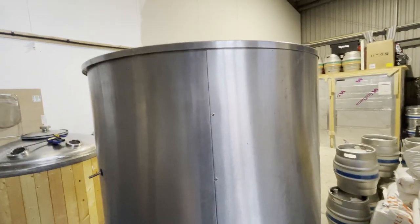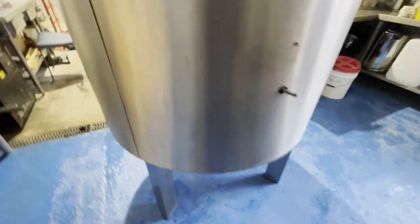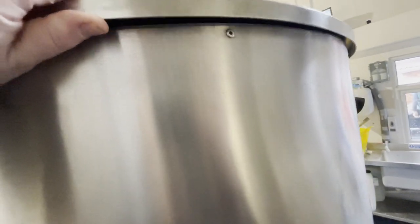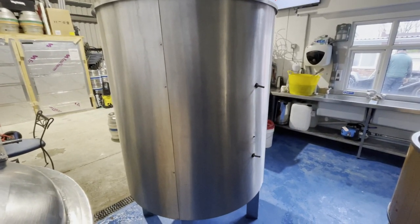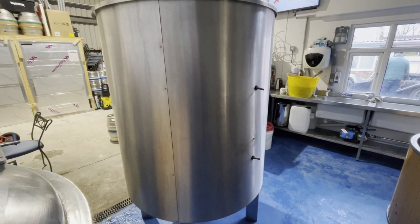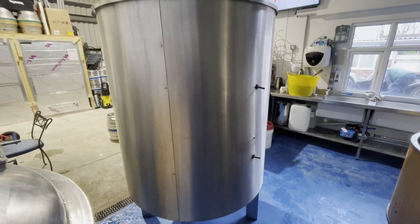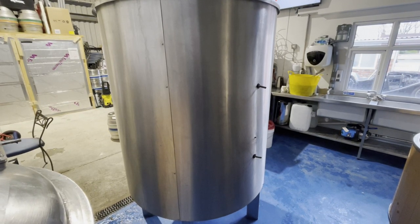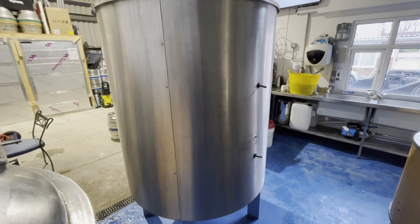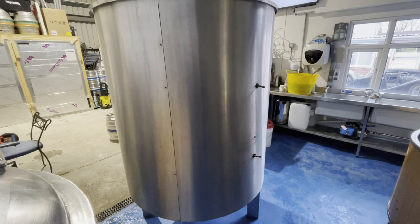But I've got to get this section out. So I think we drill these rivets out all the way down, couple in the bottom, couple at the top. I have spoken to the fantastic people at Elite Stainless Fabrications and he's telling me what to expect once I get in there — insulation, copper pipe taped down. So let's have a crack at it. They're stainless rivets and I bought some cobalt drills. Hopefully they'll be good enough — let's keep them cool and see how it goes.